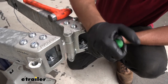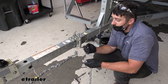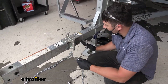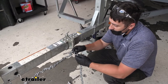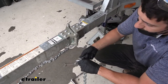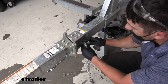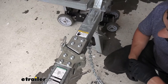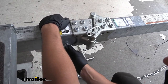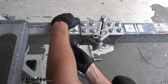Next we're going to install our safety chains into the hole we drilled earlier, behind the male portion of our hinge. We're reusing the existing hardware to secure the safety chains, but as mentioned we will need longer chains due to changing the connection point significantly further back. We'll slip a half inch bolt through one of the open end links, add a flat washer, slide it through the frame, then on the other side we'll add another link, a flat washer, a split lock washer, and a hex nut and tighten everything down.